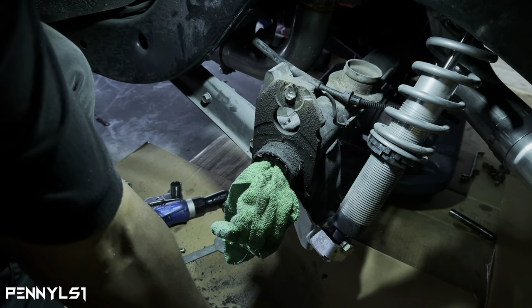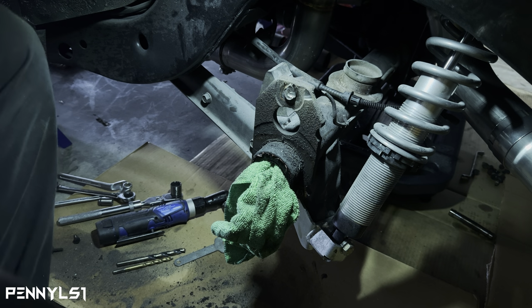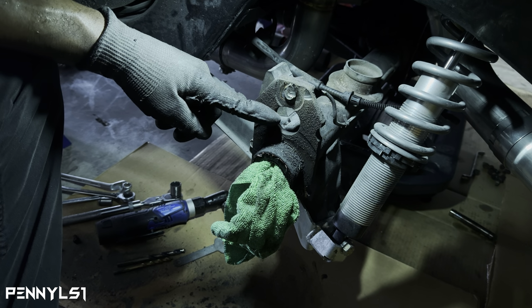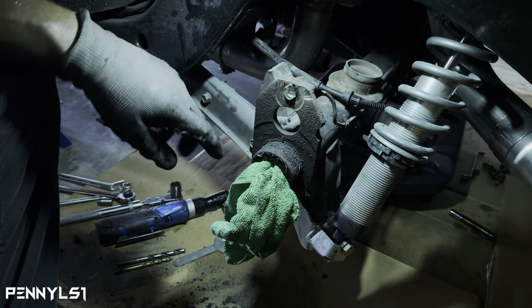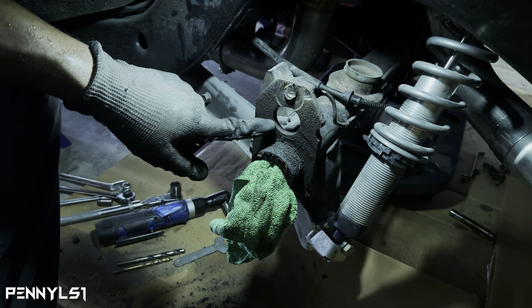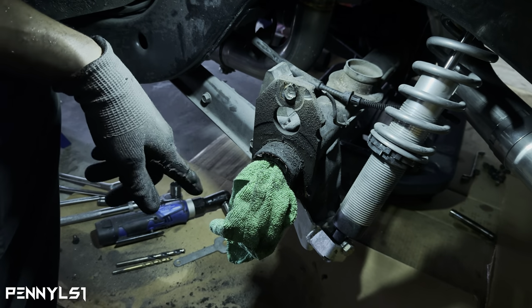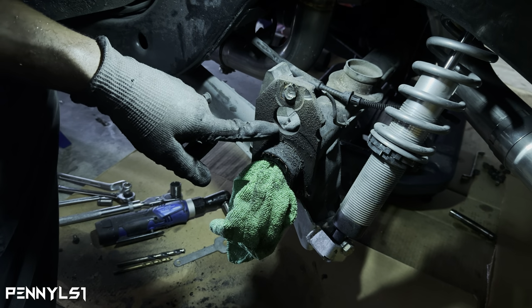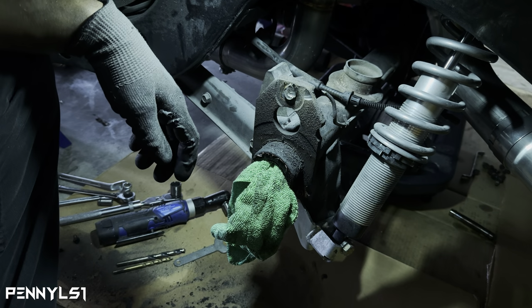I think I didn't weld the damn stud to the piece that I need to cut off, but I got the backing plate off. That's the most important. So what I did last time, I cut across here, and then I still needed more trimming to get the backing plate to fit. So my second cut, I cut right around, see that little half moon or whatever right here, and right here, or quarter moon, I cut on that edge and the plate fits right on there. So I'm just gonna go ahead and do that on my first cut. Cut right here, and then I put my flap disc on and bevel, get all the edges off.